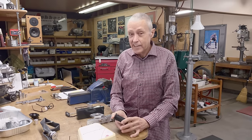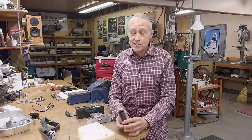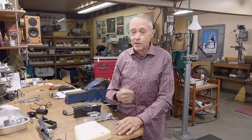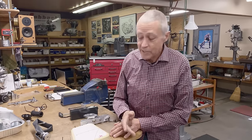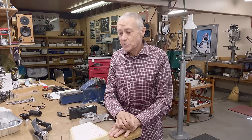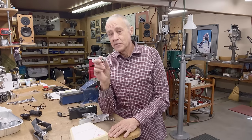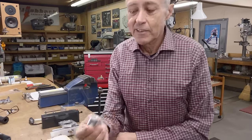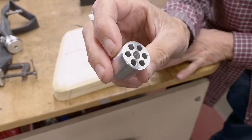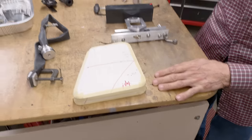It starts fairly easily, but it was running rich. I had a 200 main jet in it — that's what was suggested — and that was rich. So we went down to 190, 180, 170, and it was still rich. It was also noisy, so I made up an insert to go into the muffler. It's made out of 6061 aluminum — you can see there are holes — and that's going to cut down on the noise.